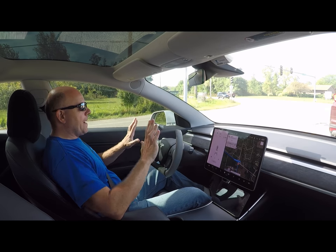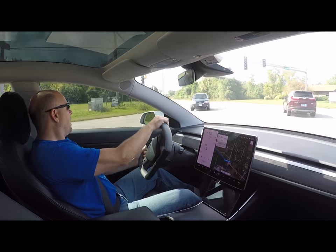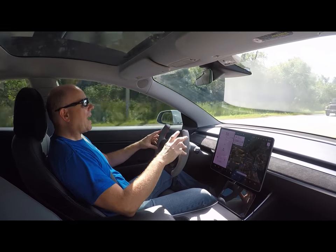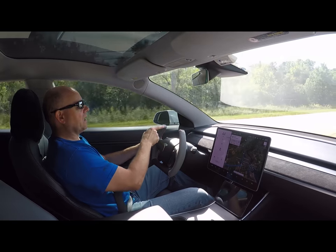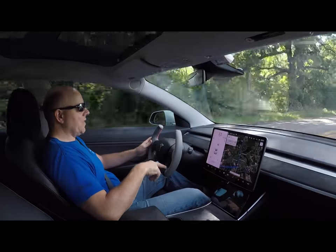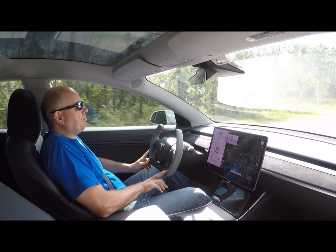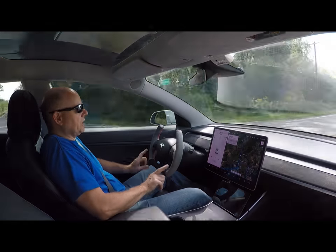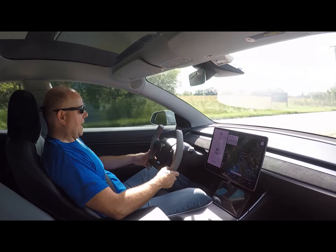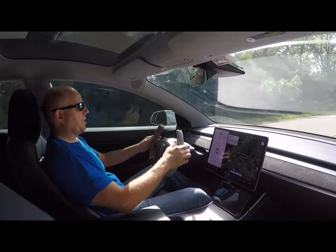This is not the wrapped version of the composite wheel — I'm still building that and have a couple of updates coming soon. This is a stock Tesla Model 3 wheel that I cut the top off of. I pulled the upholstery off, cut off the top and the bottom, then used an aluminum tube, welded plates to the ends of the tube, and bolted it with heavy-duty bolts and Loctite into the original hoop sections left and right, grafting it on. Then I brought it to an upholstery shop where they wrapped the bottom section in foam and upholstered the entire thing.